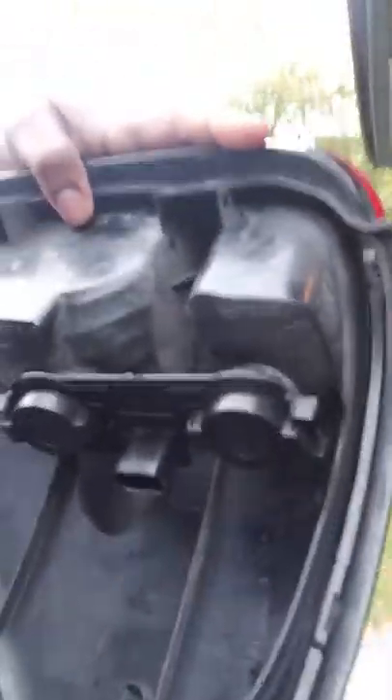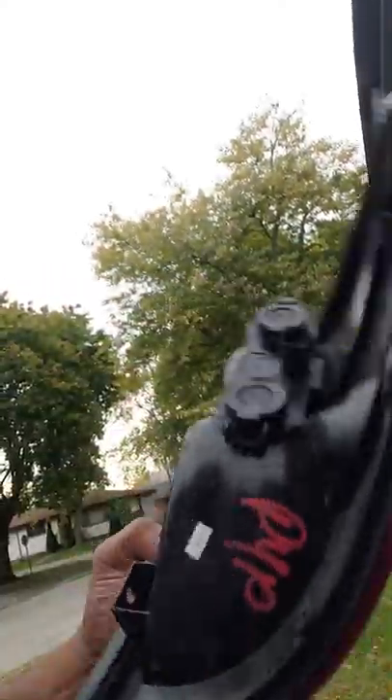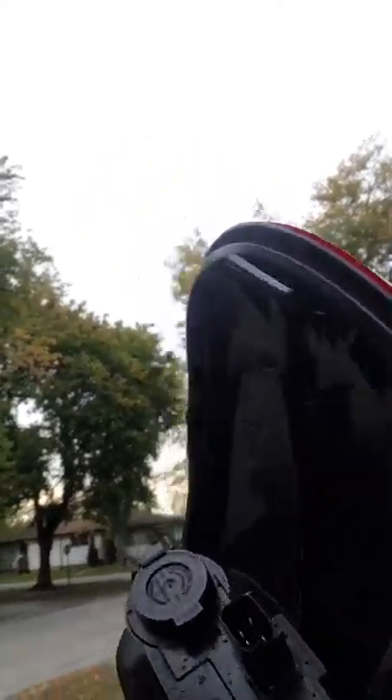On this particular vehicle, the way it's designed — it's a pretty bad design. Basically the way they set the tail light up, there's one connector going into two light bulbs on each side, and it's a little bridge that they use. It actually rusts up.